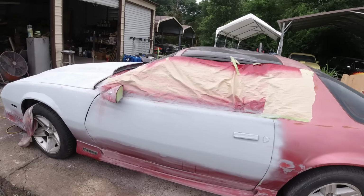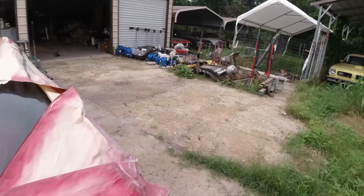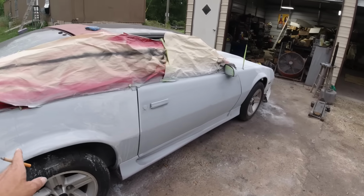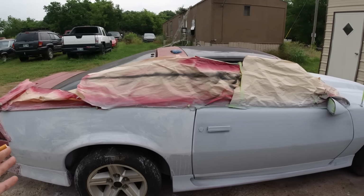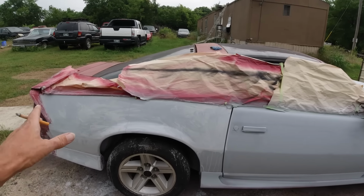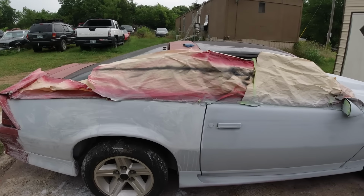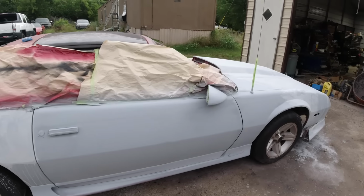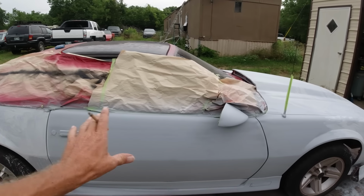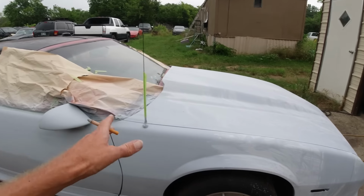Okay, on the body work on this side, I already primed it, blocked it, and reprimed it. And I've already started sanding with, well, that's actually 600 grit. I just now got some more 400 grit. So I usually final sand in 320, 400, except for the two doors. The two doors need to be blocked down and reprimed. The rest of it's, like I said, final prime.